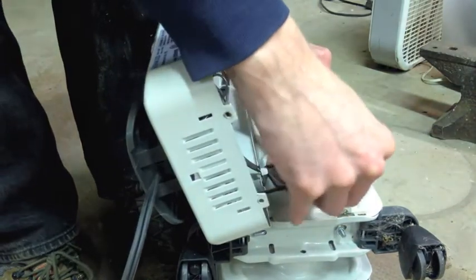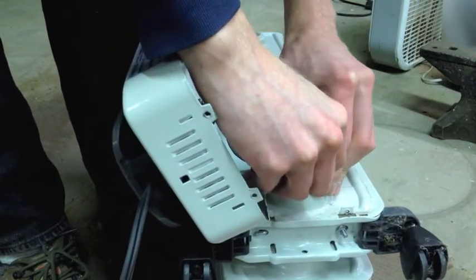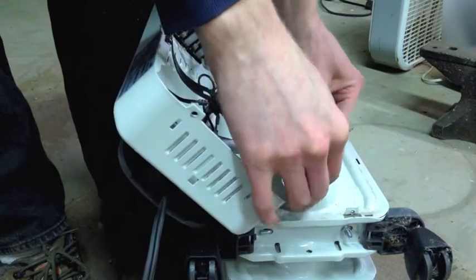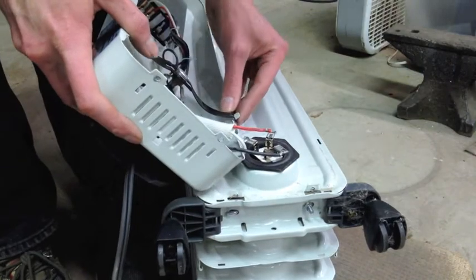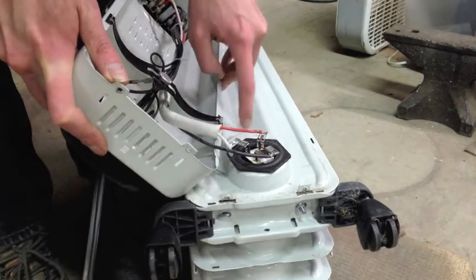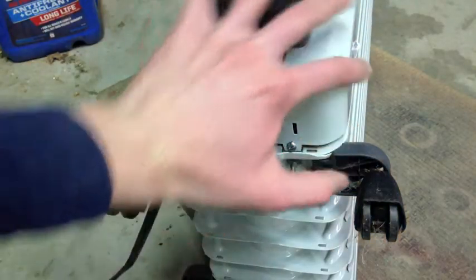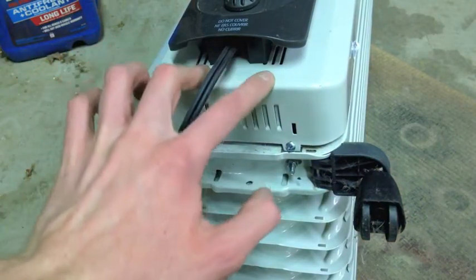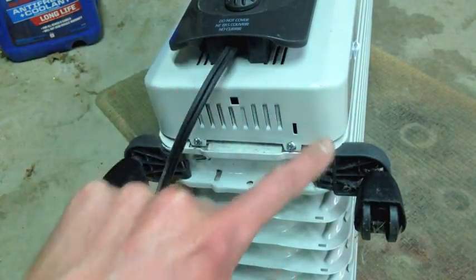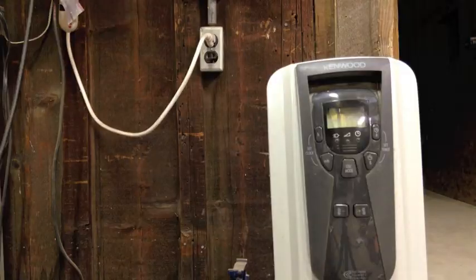Let's get common on the two-pronged one here. White on the one with no red dot, red on the one with the red dot. Now I just need to get this little hooky deal into this little slot here. This has tried to pop off - make sure that's on there. This is sort of a spring that makes sure the sensor is sitting at the correct distance. This thing just comes back down - you've got to make sure the tabs on the sides are in right so it'll sit. You have to put a little pressure against it because you're compressing that spring that holds the little fuse in there. Then just run these two screws in.